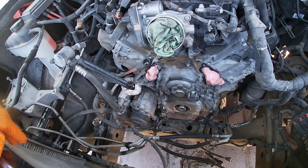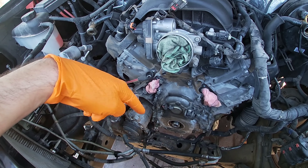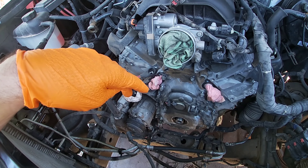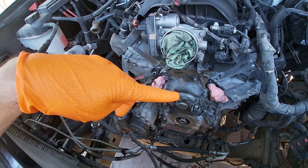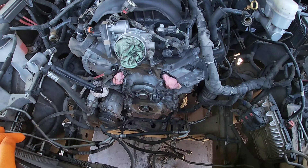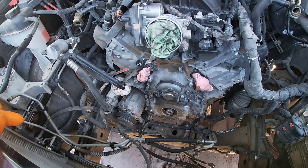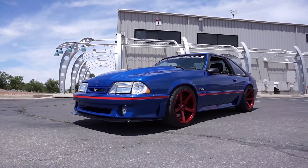I'm back working on the Chevrolet. What I'm gonna do today is start by cleaning off all the pieces — the timing cover and the oil pan. I got the parts all here so I'm ready to start getting it all back together. I got some brake cleaner and brushes. The surfaces need to be clean because these take silicone — there's no gasket on there.